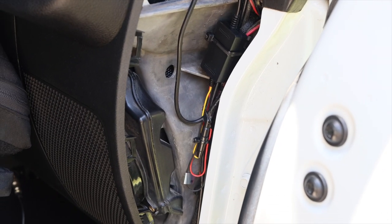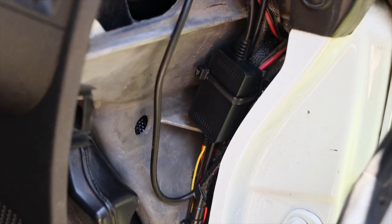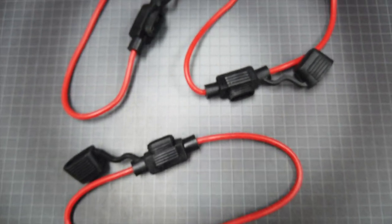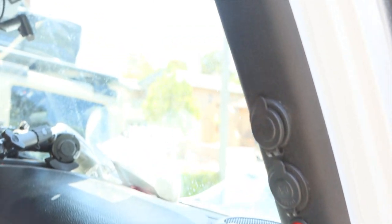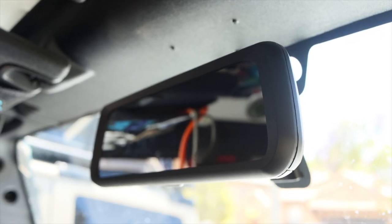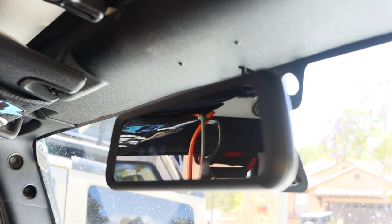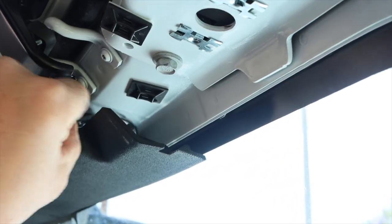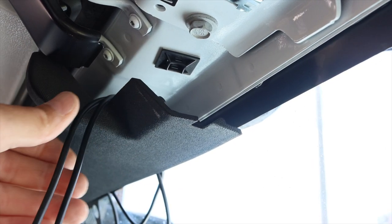The rest of the wire harness has to go to the front of the Jeep, all the way to the dashboard. On the passenger side, run the wire under the carpet. Remove the plastic kick panel on the passenger side door and feed the wire — you can secure the wire using zip ties. Remove the dashboard's side panel on the passenger side and accommodate the power harness connection box. I used a couple of inline fuse holders to power the mirror from an existing 12-volt supply wire. Remove the A-pillar panel, the sun visor, the windshield trim molding, and replace the OEM rear view mirror with the HD 9.66-inch full screen display camera mirror. Run the power cable up to the rear view mirror, connect the wires using the quick connector, and reinstall the plastic trim hiding the wires behind it.